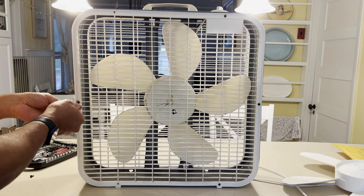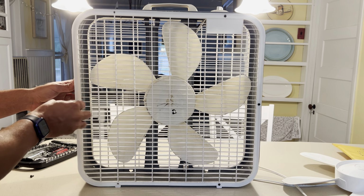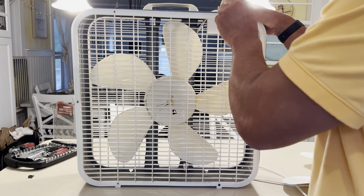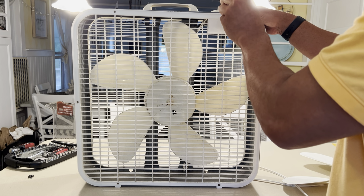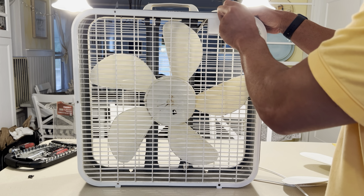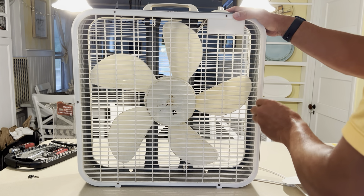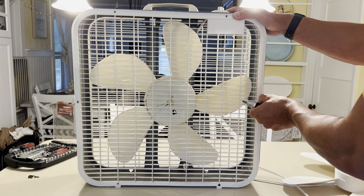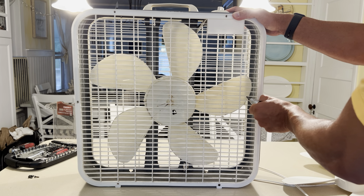One thing that I don't think is brought up frequently enough is that when you go to remove the blades, obviously you have to lay the fan down, ideally flat, unless you're dealing with something that's worn out and slides on and off fairly easily. Whether you do it on the ground, there's a technique where you put your shins on the outer cabinet, hopefully with the fan on the carpet so you're not messing it up, and use your weight to hold the fan down through your legs, and then pull up, turn the blade a little bit, pull up, turn the blade a little bit. I've seen that technique for Lakewoods, like the P223s and whatnot. Lakewoods are very difficult, I have found, to pull the blades off of.